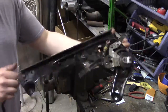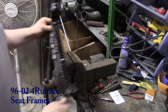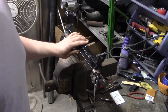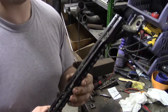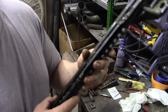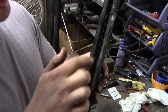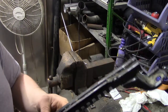We don't need this anymore — this is the old seat frame from the Tacoma. Now I'm going to grab the same side from the 4Runner and do the same exact thing. Just want to point this out: on a Tacoma, on the passenger seat rail, there's a slider. I'm going to take this off — there's a weld there, a weld there, and a weld there. I'm going to grind those off and pop it off, and it should be good to put onto the 4Runner seats.